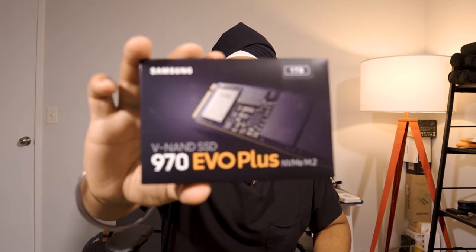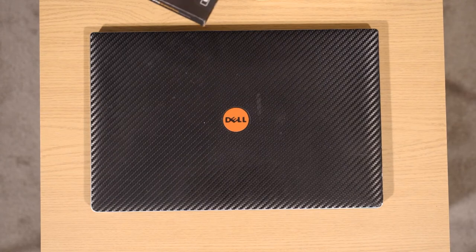I ended up purchasing this — the Samsung 970 EVO Plus — for my PC. I just had the 970 EVO, not the Plus. The Plus has a few more benefits compared to the regular one. So what I'm actually going to do is take the original 970 EVO that I put into my PC and put that into my laptop. Then I'll take the EVO Plus and put that into my PC, because I want the PC to be my workhorse editing station. And I'm going to take the NVMe drive out of my laptop and put that into the secondary slot in my PC — because of the motherboard I have, I'm able to do that.